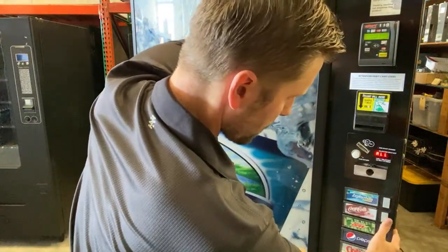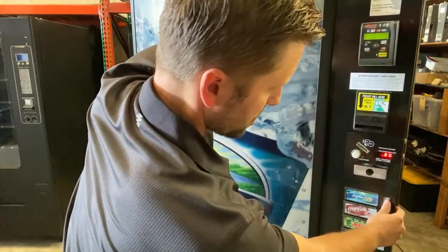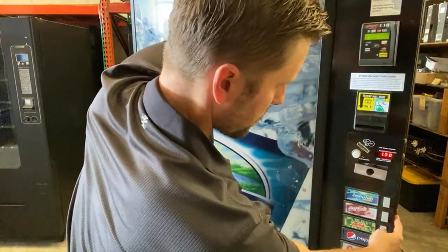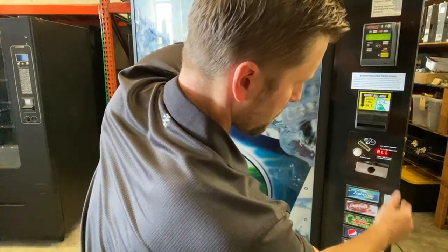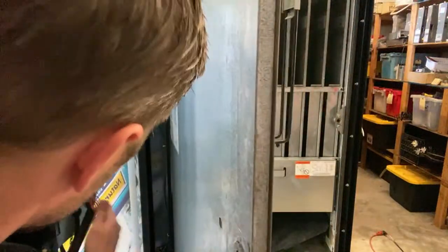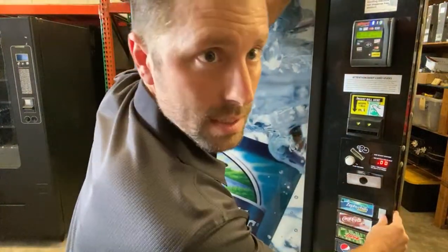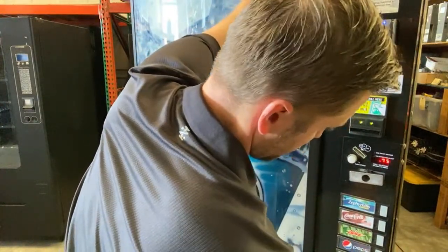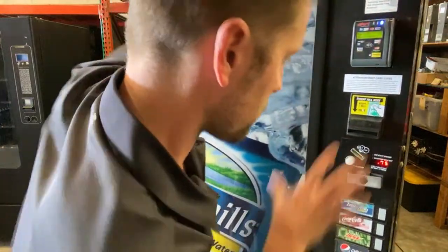But we wanna change the water to a dollar. So when it says all, selection one now comes up. We're gonna enter. I'm gonna change that. Hold on the first button to $1. Enter that in. Go back, I'll see. I might have not saved it, let's see. So we'll get out of there. We'll go out, so now we know it's not in service mode. We'll click this one, $1, 75. Press the selections. So the cans are set for 75 cents and the water for $1. So now it's priced.